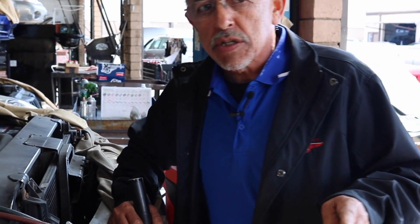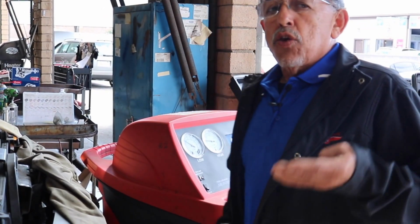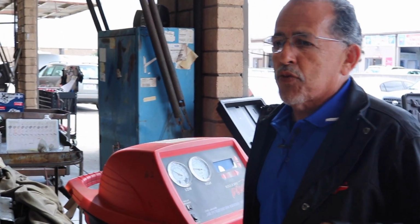And on some cars, like if you own a Cadillac, for instance, and some of the Volkswagens, if you own a Cadillac and the air conditioning system stops working because it's low, then you cannot get it restarted unless you reset the computer. So you got to get somebody to do that. Don't go crazy thinking you got an electrical problem. You got to make sure that it gets reset.